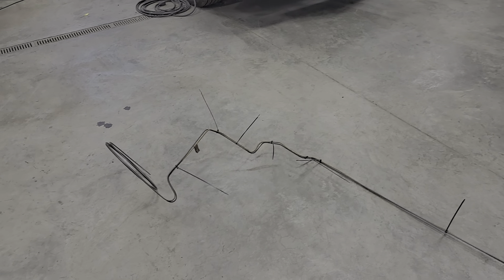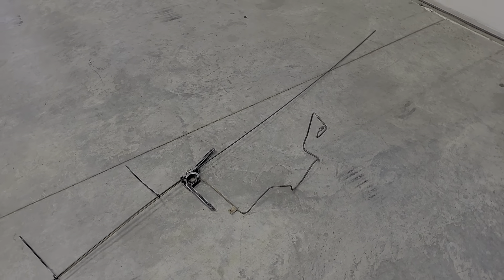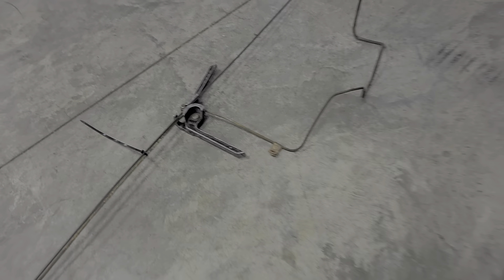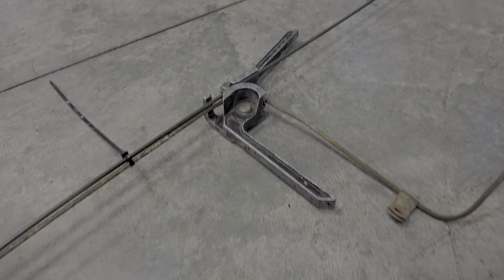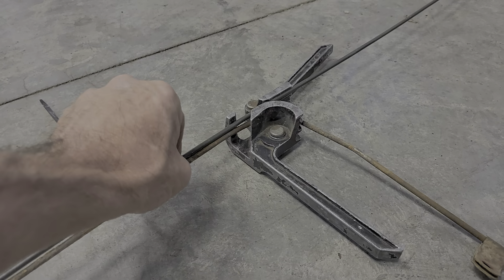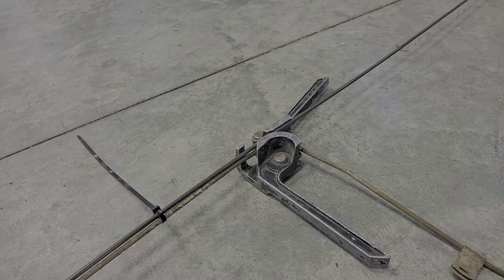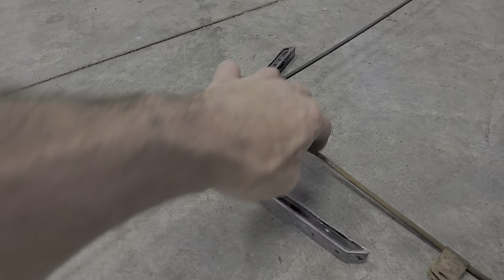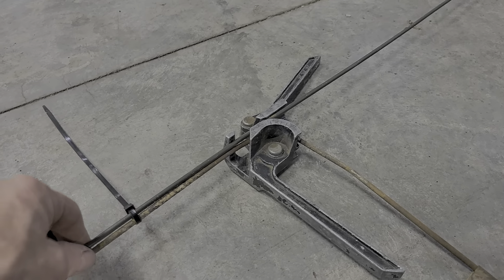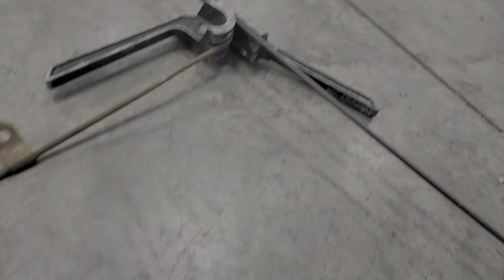It's quite a little bit of forming there. I'm going to show you the other end quick before my battery dies. So what I'm doing here — the trick I'm finding — is I'm keeping my new line on top here because my outside groove is for my 3/16ths. And then I'm keeping my old tube under and actually throwing it into the quarter-inch groove.